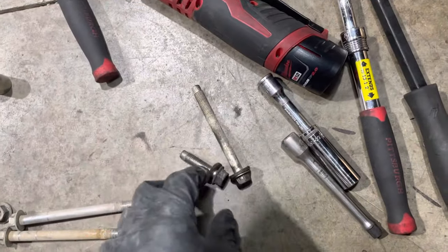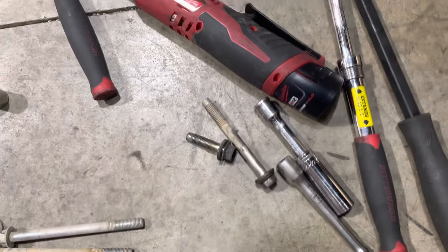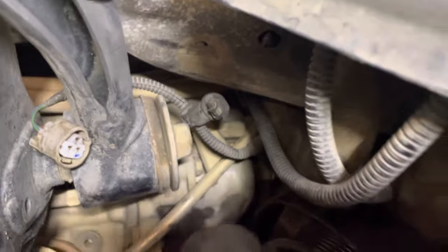If you're questioning this job, these are the two bolts — top bolts, long one and short one. You go through the front of the pulley. Right here is the plug — you unclip the plug, and then there's a bracket there that you unclip from. You squeeze each side — you see the clip right there — squeeze each side and pull it through.